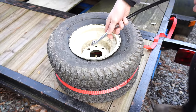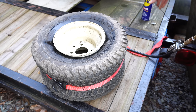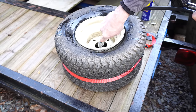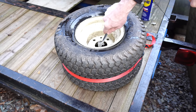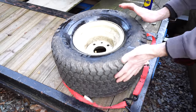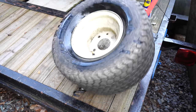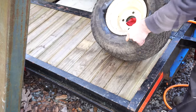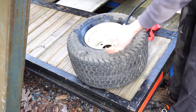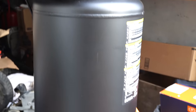Sometimes you'll have to use a ratchet strap like this. Liquid also helps seal the bead and helps it seat. Watch out though — this is going to be under a lot of tension; you don't want to get hit by it. Pay attention to the maximum inflation rating on these tires. This one says 24 psi, so you don't want to go over that even just to seat the bead. I only went up to 20 psi to seat this bead, and I'll run it at about 10 or 15 psi on the tractor. You do need some kind of compressor to seat beads — you're not going to do it with a little electric pump.